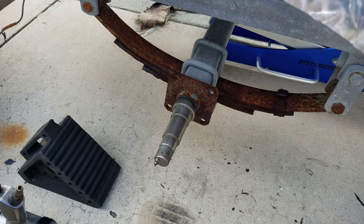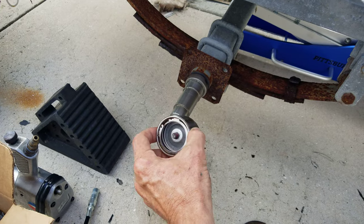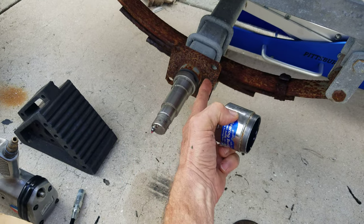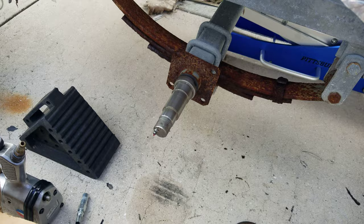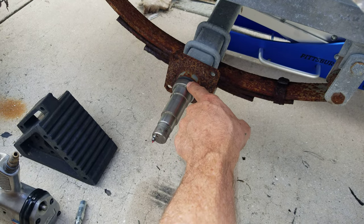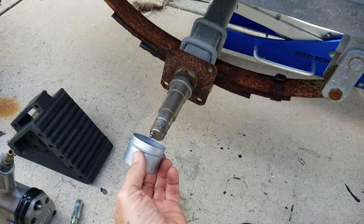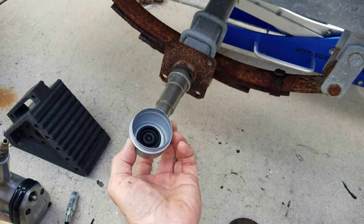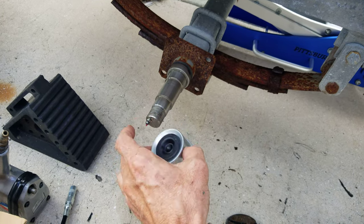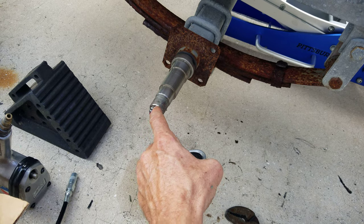When I got the trailer I didn't realize it, and I put these on it. This bearing buddy system here pushes the grease up against the seal — eventually it'll blow it out. The other system is much better: it pushes the grease from the back towards the front and is less likely to cause a seal blowout. So if you have this kind of dust cap on your trailer, you need to take it off and pump some grease into these fittings.